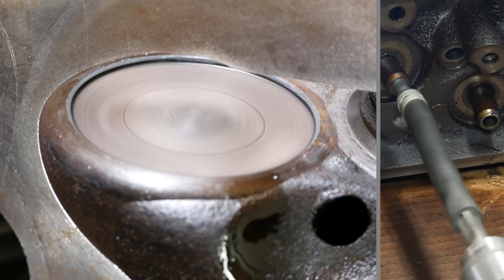We'll keep on moving forward, and once we're done lapping all of the valves in both cylinder heads, it's time to wash them off. We'll take both cylinder heads outside and set them down on a few blocks of wood to keep them lifted off of the ground. Then we'll give them a solid coating of engine degreaser — this is just generic Super Tech branded degreaser — and we gave the heads three coats of it. We'll let these sit out in the sun for about 15 minutes after that first coat, then fire up the pressure washer. Just like we did for the engine block, we're using this turbo nozzle to get some really solid cleaning action. There are a lot of corners and curves in these castings, and we want to make sure we hit them all, focusing on both the outside faces and the insides still filled with rust and grinding compound.